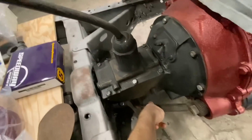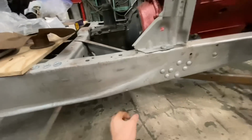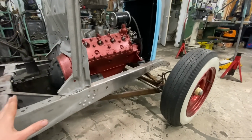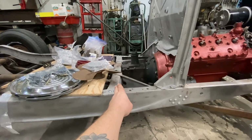One, we can cut the wishbone here, move it out to the side, put a tie rod end on it, put a perch there, and have split wishbones. But I don't want to have split wishbones. I want to keep them together, especially with using this '32 K-member.